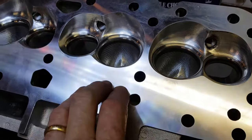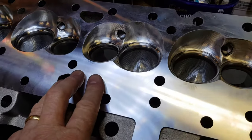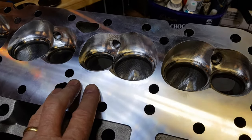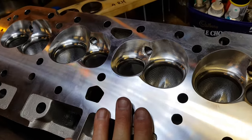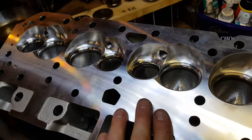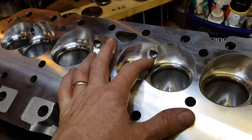If there's something we can do to shape these up - which is normally done out of the head, I won't go into how they do that - it basically lets the valve go in more, which will change my installed height and affects other things. But if that's what we've got to do to get some longevity out of these seats and valves, then that's how we should be setting this up. I'll take advice from these guys and see what they say tomorrow.